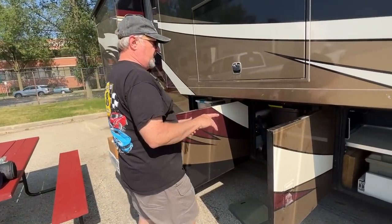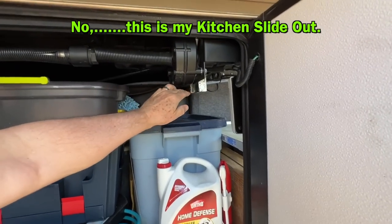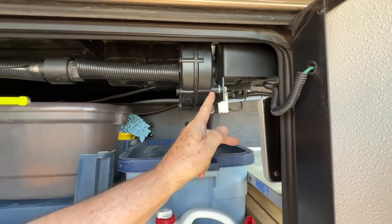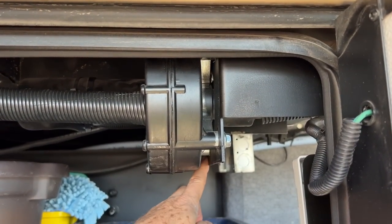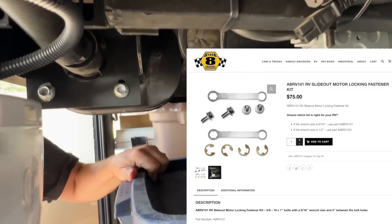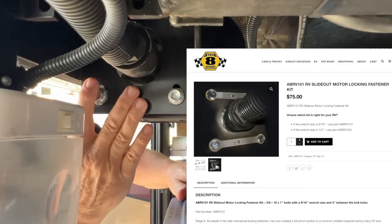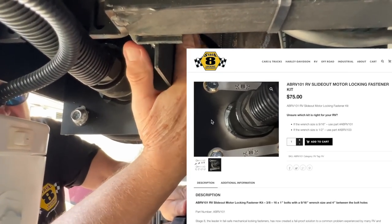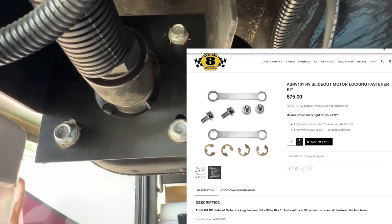This is my bedroom slide, and it has only one gearbox — a big oval-shaped gadget. It has a bolt that goes through here into this hub, and it's these hubs that are ever so fragile. There's one, two, and then one on the top — three, four. The bolts you need to keep tight are these, and you can see these are relatively easy to get to. Things start to get progressively more complicated when you've got to get the top one on each side.